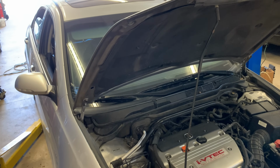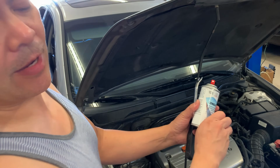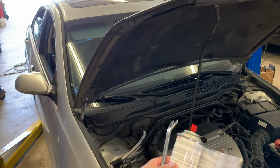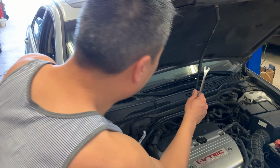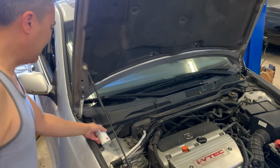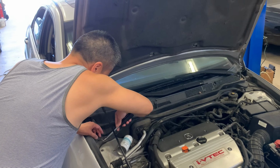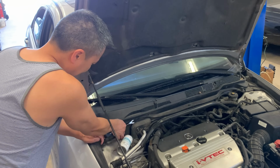All right, so these Toyota ones on the cleaner and on here, there's instructions. Yeah, there's instructions on both. So please read. So this one here, you want to have the cabin filter out. We want to spray into the inlet here, air inlet. So that would be under the old cowl here. So every car is different for trim panels.